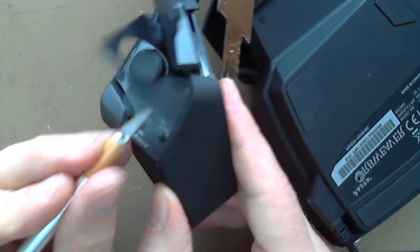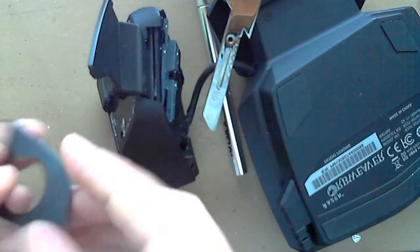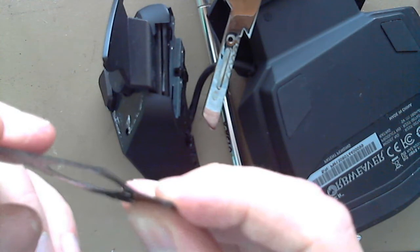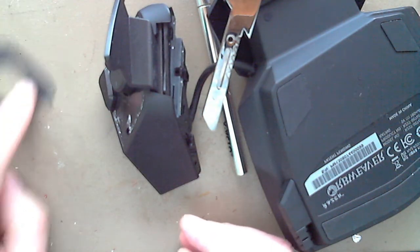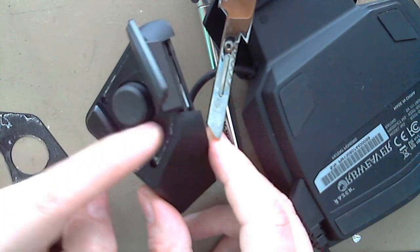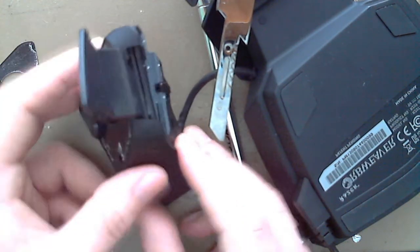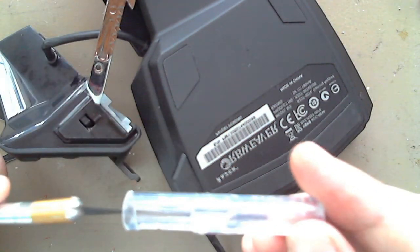Here it comes. This is either an older orb weaver that had the metal plate, or Razer has gone back to this. I'm going to have to ask him where he got this from, if he bought it new or used. But this is much easier to work with and it's just better. The downside is that to get the joystick to fit, you have to kind of cut around this plastic — I'll show you in another video. You also have to make the same notches into this hole here. And I'm putting the X-Acto knife away because my children come back here and will cut themselves.